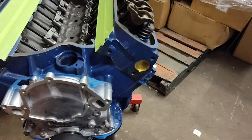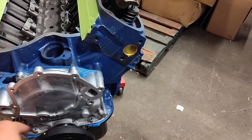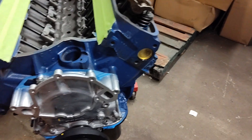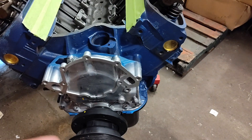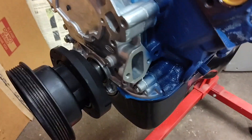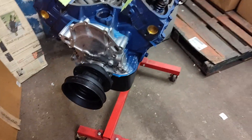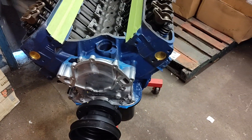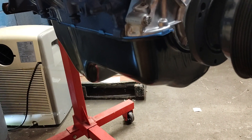When I put the water pump on I'm going to have to swap plates on it, because I'm using an old-style timing cover and late-model water pumps actually have a different port arrangement. But you can swap the plates around on the back of them, because I'm running a late-model serpentine belt setup on this engine, but I wanted to use just a regular old mechanical fuel pump to simplify my life.